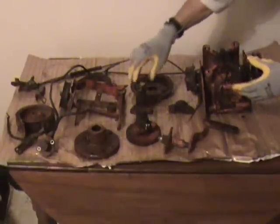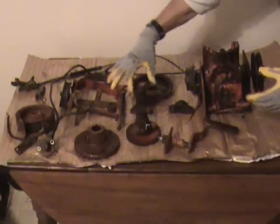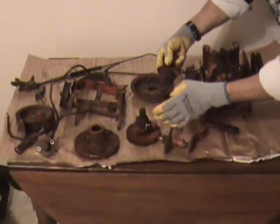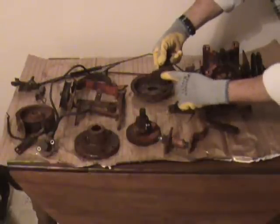Also, the steering gear — '64 and earlier, I think it's '65 and earlier — had two-piece gears. The block is in really nice, good, tight shape. Almost no play in that at all. And like I say, plenty of dirt, grease, and grime. Another nice thing I noticed was a new grease zerk was added. If you've got a new grease zerk, or piles of grease around grease zerks like you can see here, you know that something's been taken care of and the maintenance has been done on it.